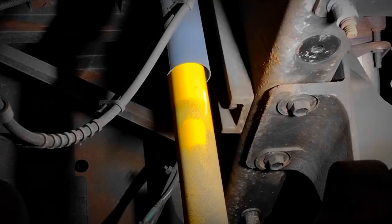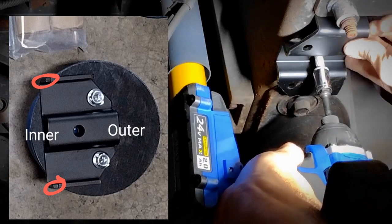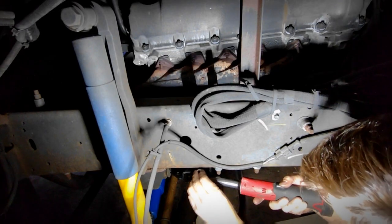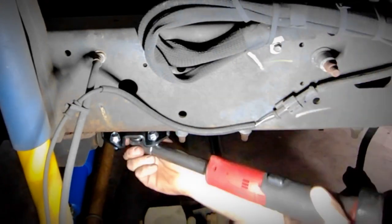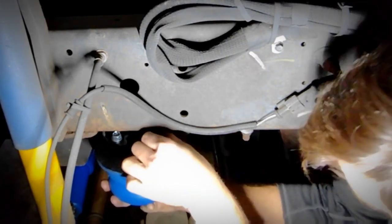There's actually a captured nut through the frame, so you just need a half-inch socket and extension to remove this bump stop. Now that we have the factory bump stop removed, you'll reuse this bolt. On the fastener side there is no nut — you use this bracket. There are raised edges that hook on the inner part of the frame, and the cornered-off 45-degree pieces face towards the outside toward the shock. Start your bolt and thread it up into the frame itself. Loosen the bracket a little bit to drop the bolts in that hold the bump stop, then mount the bump stop to the bracket with the two 3/8 by 1-inch bolts. It will save you some time to have a 9/16 ratchet wrench for this job.